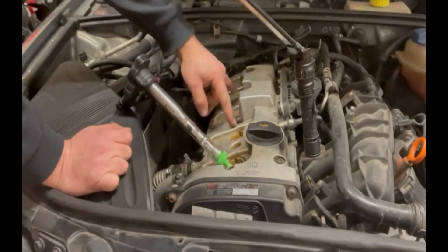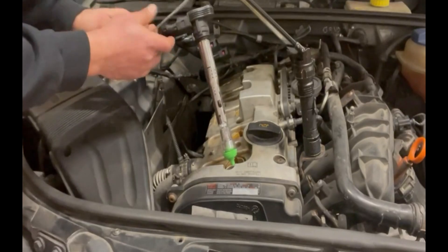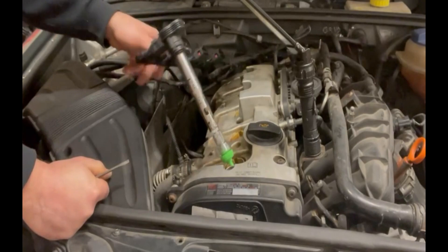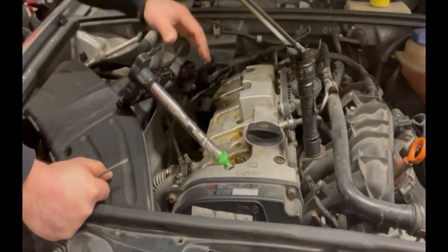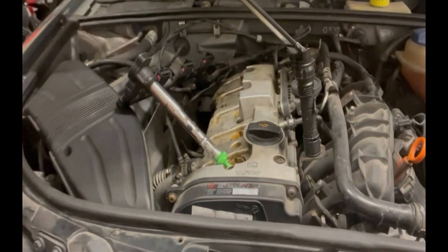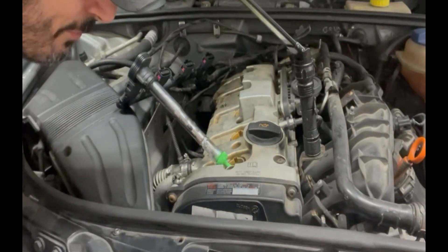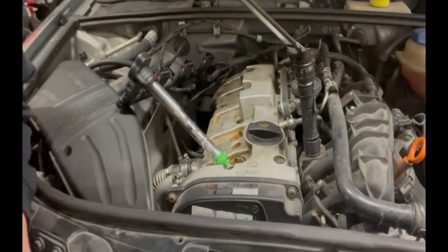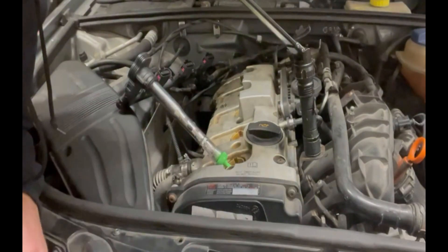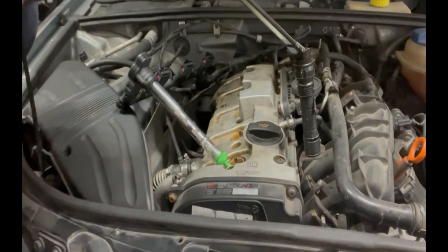Alternatively, if you wanted to have all the other coils in the holes while testing, all you'd need to do is take off this plastic retainer, and that would free up the wiring for your individual coils — allowing you to have the tool on one coil and all the other coils seated in the spark plug holes. I hope that was a little bit informative. If you're not familiar with how these work, I hope this gives you an idea how to do it with this type of coil setup on these vehicles. Please give me a thumbs up, consider subscribing, and have a great day — I'll see you on the next video!